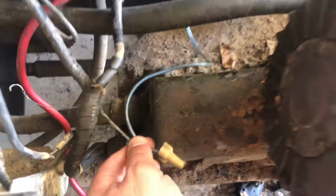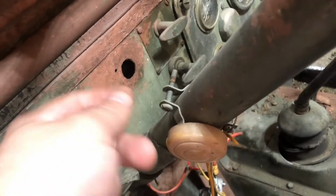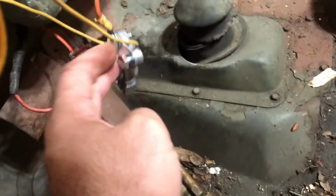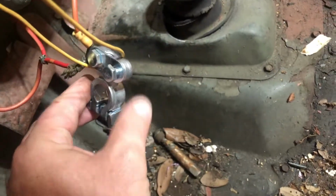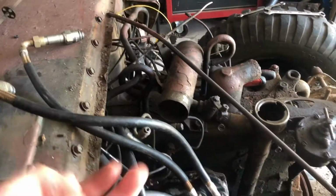So once I got all this stuff figured out, there was only one other thing left to do, and that was for an ignition in the Jeep itself. There is a wire here from where there was a key start, and one time when it was in military service, there was a little on-off switch there, which was taken out, and a key was put in, right? So these wires were hanging down here. I actually just used the leftover clip I had to hook everything together, and as soon as I made all these connections, I put a breaker bar on the starter solenoid lever down there, and it has a really good strong spark. So we've gotten that worked out.